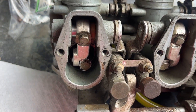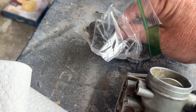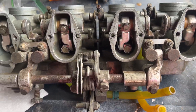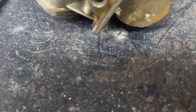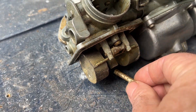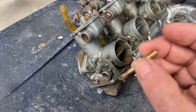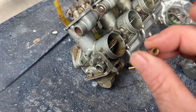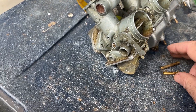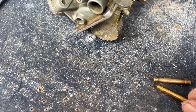So I have to take off these two bolts, pull out the slide, put a screwdriver down there and pop the emulsifier tube out the bottom. You have to be careful because you don't want to damage it — these are actually pretty nice and you might want to reuse them, but I think I'm going to throw in a brand new one, although they're looking like they might be different sizes.